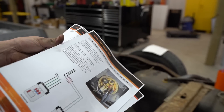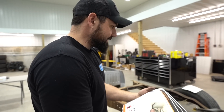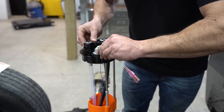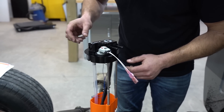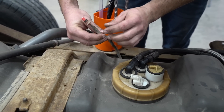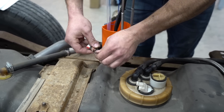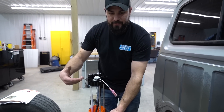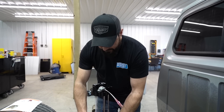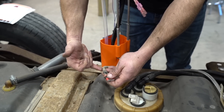Don't overcomplicate it — it's very easy, no issue with the connection. Click, bada bing bada boom. Where all the wiring is rigid you get down into the nice section, and you can separate this connector. The last thing you want to do is put this in and still have issues, so you need to make sure your factory wiring is good. On 91 to 93, factory connected you have a green, blue, and yellow stripe — you can see them matching up on the diagram.